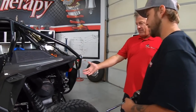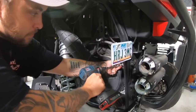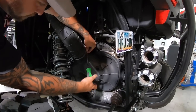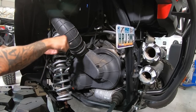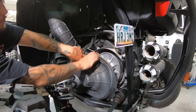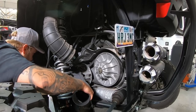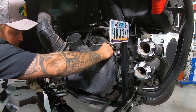Mitch, go ahead and pull this cover off as if you were driving in the dunes and lost a belt. On a Polaris, there are a couple of different clutches and clutch tools; there are some really nice aftermarket ones. Belts are basically the final drive mechanism and a good portion of what you'd call a transmission, transferring power to the back drive through the trans gear. The high and low gear ratio is the clutch function, and all of that goes through the belt.